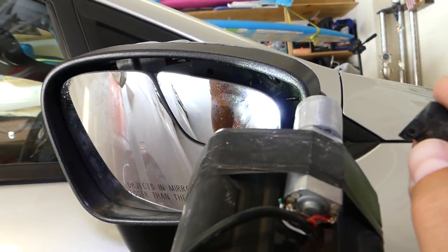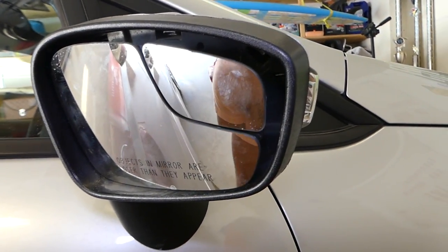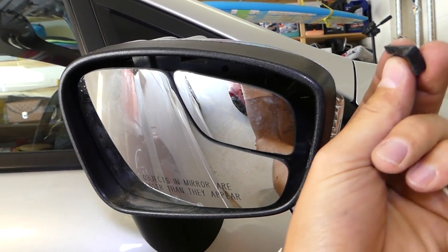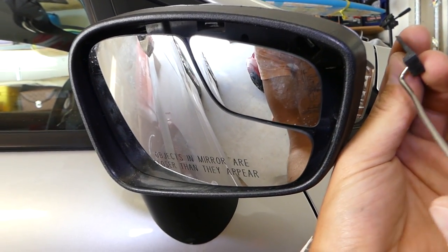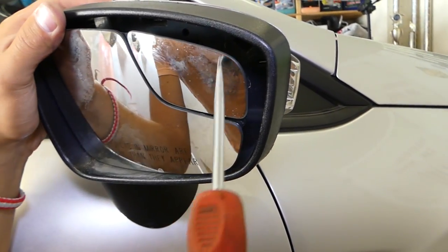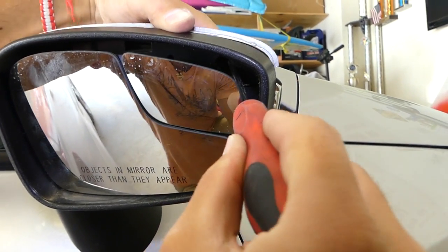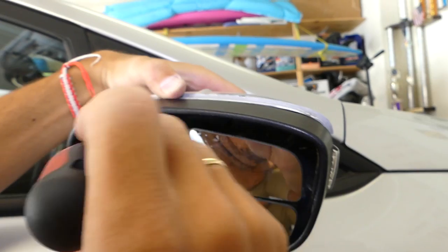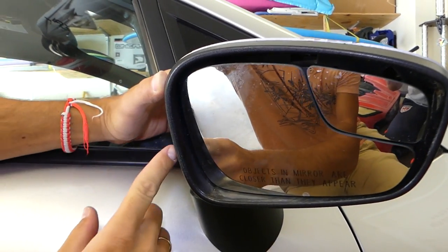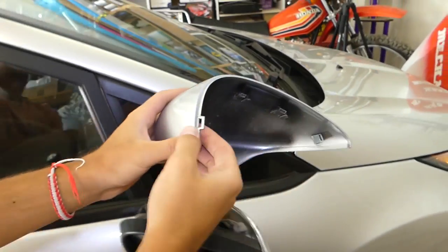That corner clip has a cap on top of it, so you won't be able to see the clip because the cap is covering it. What we did was grab it with one of our tools — all tools we use are listed in the video — and pulled it out. Then just use a flat head screwdriver and push the clips out. There is one more clip on this side, so be gentle how you pull it out — that's the fourth one.